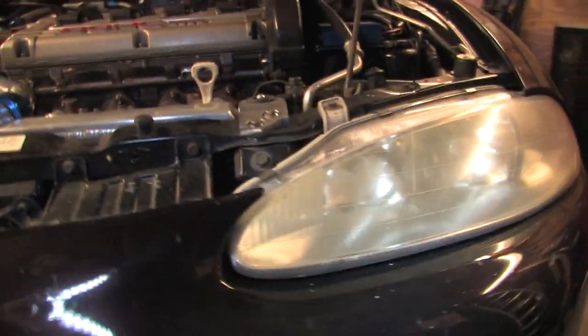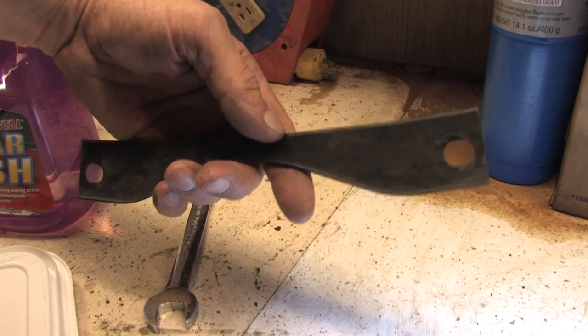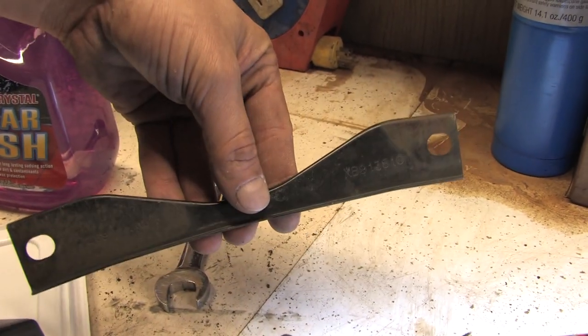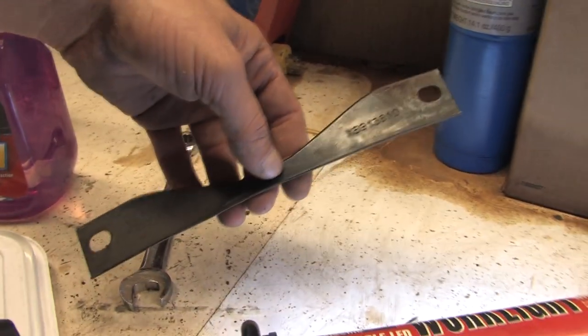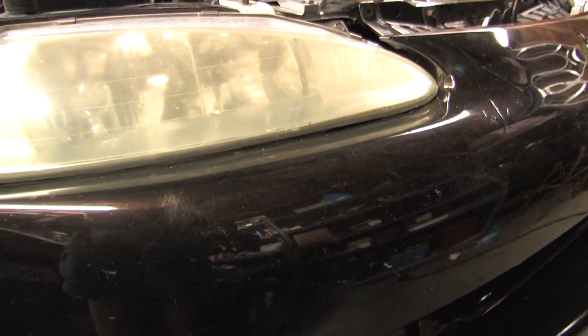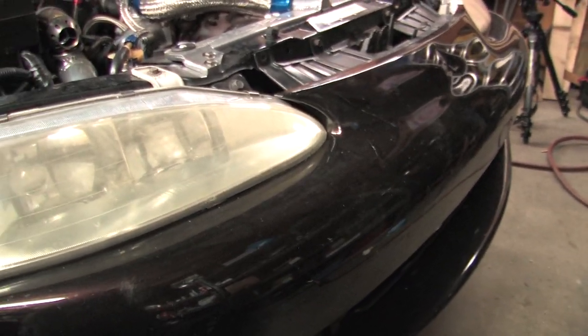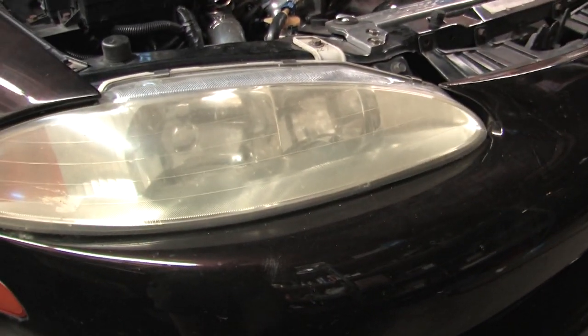What I do after I've done this kind of job so that I don't have to remove the headlights to take the front bumper off — I've left out that part. This is what it looks like right here. It's just a little piece of metal with two plastic push fasteners that go through it and the bumper and the front fascia. In order to take the front fascia off you have to have those fasteners out. I haven't found any necessity in keeping them — it's just made the car easier to work on. And since I still have the front bumper assembly inside, it holds the front end in shape, so that doesn't really need to be tied down there.